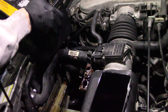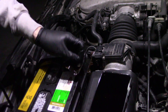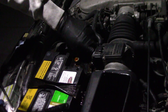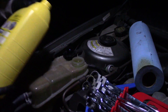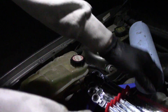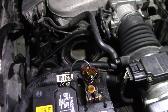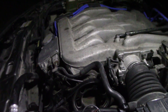I guess the battery can go back in; fill it with coolant now. That's all the tightness you need. Now these clamps — you don't want to go too tight, so you can't rotate it. It should be tight enough. That's full. Pretty sure I lost more than that. Let's start it up, get that coolant circulating. I'll have to drive around to get the coolant to slosh around down in there, but for now let's put this cover back on.